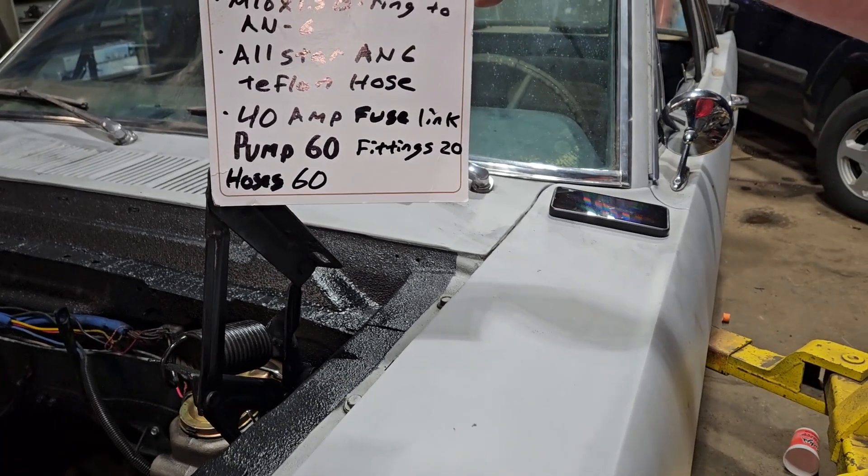There's not a whole lot to it, but here's a side note: there are a lot of internet wizards and confusion on what these fittings are. What size are they? Are they M16? Are they this or that? Speedway sells two for a T-Bird power steering rack, which is what all Mustang two kits are based off of. There's M16 and M14 by 1.5, or there's nine-sixteenths and five-eighths by 18 threads per inch. Turns out they're the same — the exact same. Whatever you can find, that's what they are.